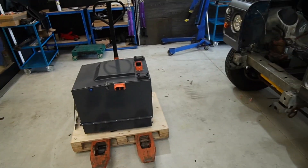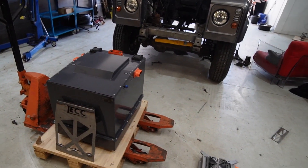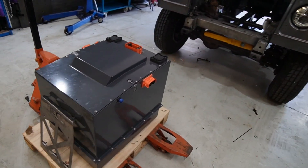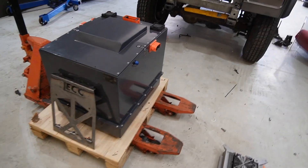Although it's only 55 kilowatt-hours, it has DC rapid charging. DC rapid charging comes out of the HV plus and minus terminals there, and that allows the car to charge in let's call it 30 to 40 minutes from 20 to 80 percent.